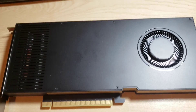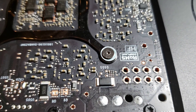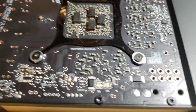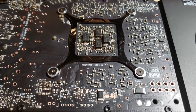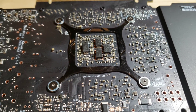Alright guys, I'm running out of dumb ideas. This time I threw the little washers on the backside — just to give a little extra tension. Don't want too thick though; you don't want to crush the GPU die. Just using M3 little tiny flat washers, so hopefully just a little more tension. I took it all apart again just to make sure everything was sitting right. The 1mm pads are working great, had great contact with the heat sink. So maybe just a little more tension on there. One more time, let's go.